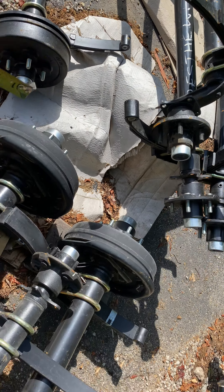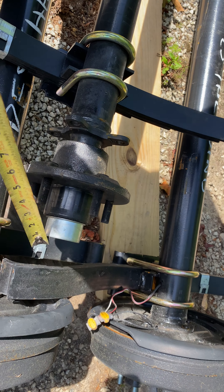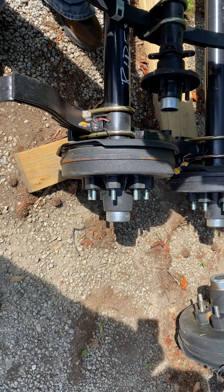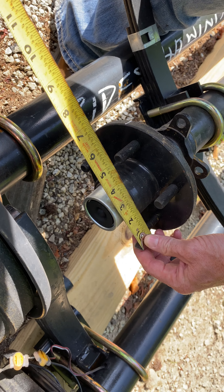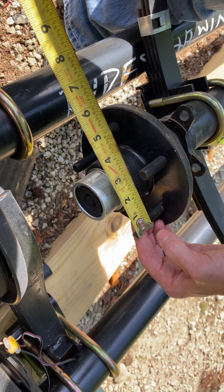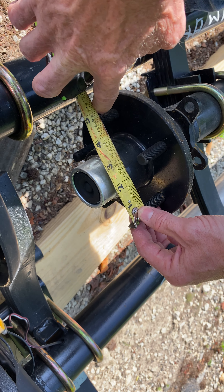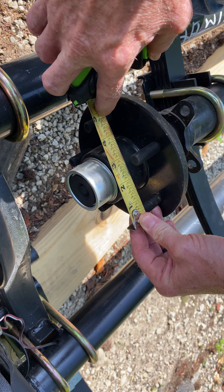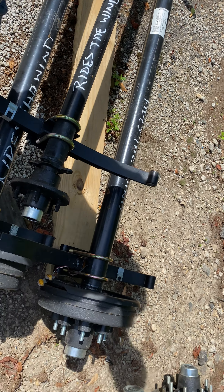You're probably going to have five lugs, but you need to know your lug pattern. The easiest way to measure it is to put the tape on the end of one stud, on the end, to the center across the pilot to the next stud. That's four and a half inches. That is the most common, but there are other ones — you need to know that.